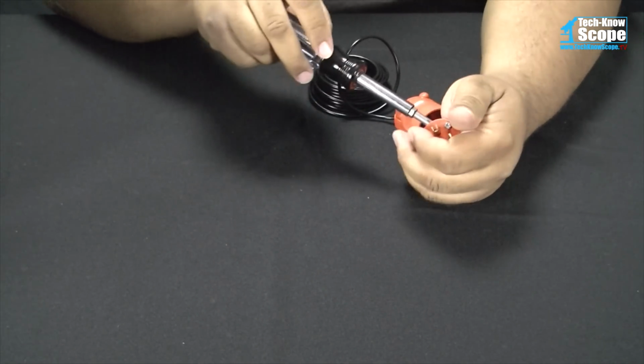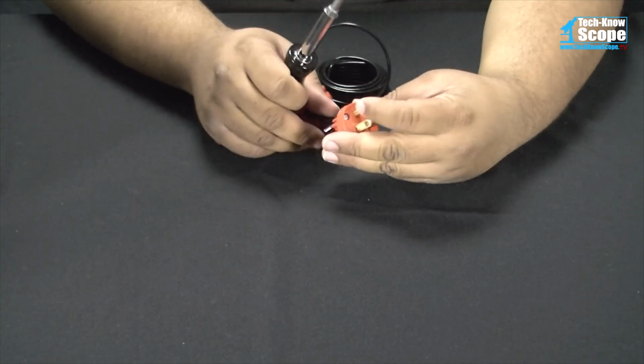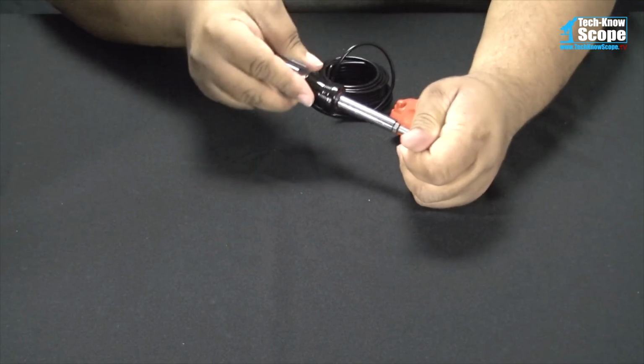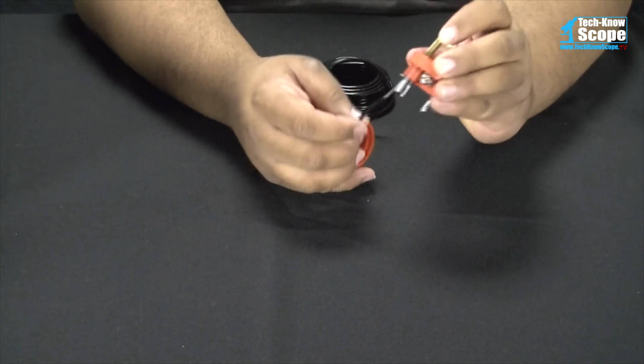And basically, what that resistor does is, if for some reason you do get shorted across a high voltage power source, everything is not trying to run through your body. That resistor basically limits the current. That way you might get a nasty shock, but there's no way that it can really hurt you. With it directly wired this way, it could.